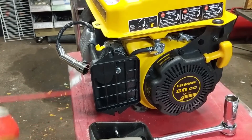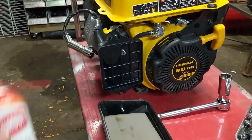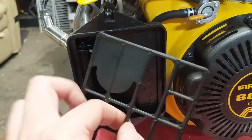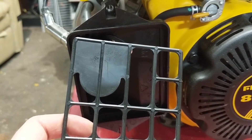Basically you're putting fuel into your engine and bypassing the carburetor — so using a little bit of carb cleaner is just another way you can test for spark. Moving on, in order to remove the carburetor I'm going to have to remove this little mesh piece. There's a solid piece of plastic up near the carburetor that limits some of the airflow going into the carb — it acts as a restrictor plate. That plastic piece limits the amount of airflow going into your carburetor, and when there's less air there's more fuel, which richens your fuel mixture — what you want in the wintertime when it's cold.